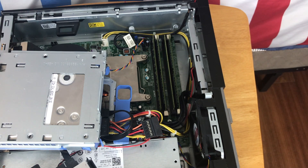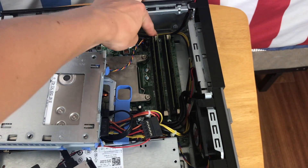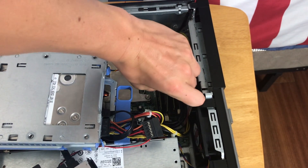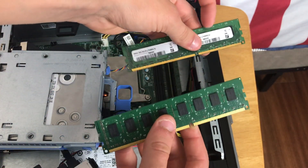At this point it is super easy. If all your slots are full — say each slot has one gigabyte and you want to change each one to two gigabytes a piece — it will likely just have two slots full of two gigabytes. To take the sticks out, all you have to do is pull these tabs on both sides and they come out just like that. Super easy process.